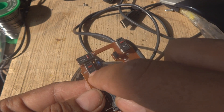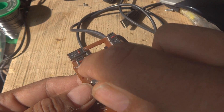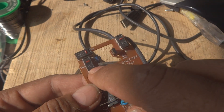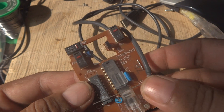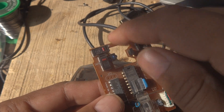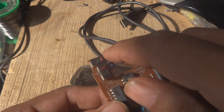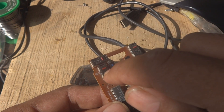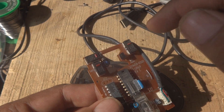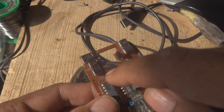This is the left click switch, and this is the scroll wheel switch underneath the wheel — it functions when you are scrolling. We use that scroll wheel click function very rarely. So the plan is: the left click switch which is defective — we will swap it with the scroll wheel switch position, and put the good scroll wheel switch in the left click position.